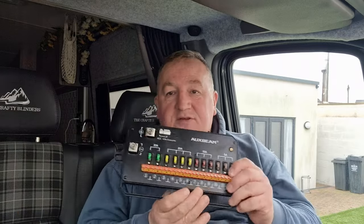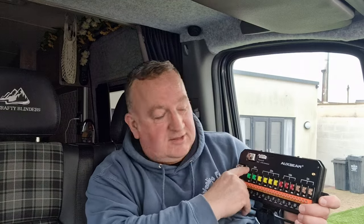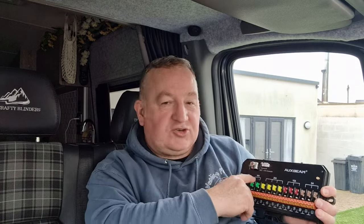What's so good about this panel? Well, a mechanical relay is quite big, quite bulky. They have lots of moving parts in them and they're not very reliable - they fail quite a lot. This Aux Beam panel has 12 solid state relays, all stuck in here. Solid state relays are electronic relays - they don't have any moving parts, and they are the brains behind this operation. You can delegate to each one of these solid state relays a function: it can be a toggle switch, a momentary switch, or a pulsing switch - so no need for any other relay.